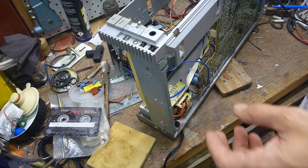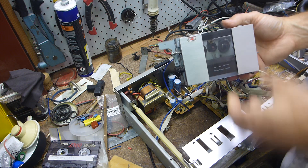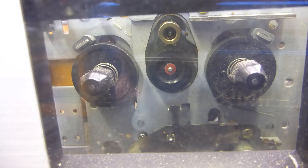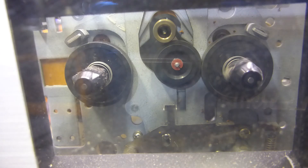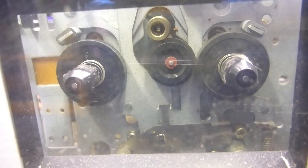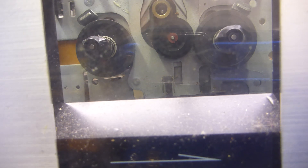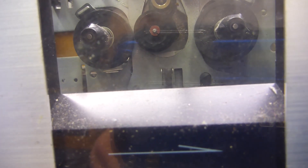That's how you get the tape mechanism out - I've never seen something flop out like that before, a bit of a surprise. At least we can have a look here. Press play and you can see there's a knurled wheel here that drives a little rubber drive wheel, which drives each belt. Then there are little clutch pads there and another clutch pad there.